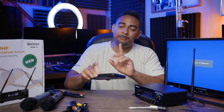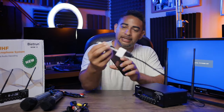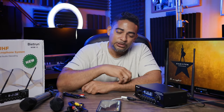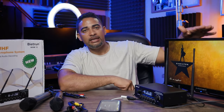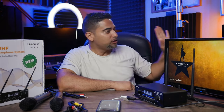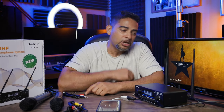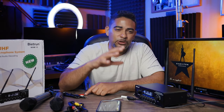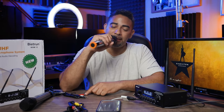We're going to use my phone for this example. I've got an adapter here to connect it to my TV so it can mirror what's on my phone to my TV. So now I'm using my phone as the output source via this HDMI dongle going to the TV, and the optical is coming out from the TV going into our mixer, which is then sending audio out to our PC speakers. Of course, you don't have to use the optical since the signal is already going from the HDMI to the TV — but this is just another way. You have so many different ways to connect your devices to get the sound in and out.